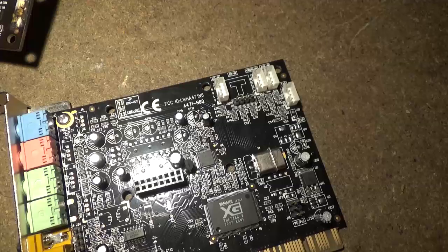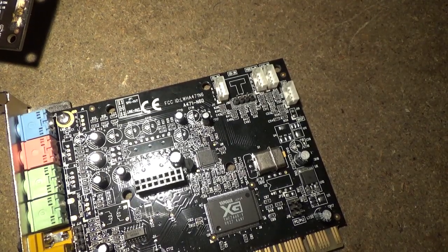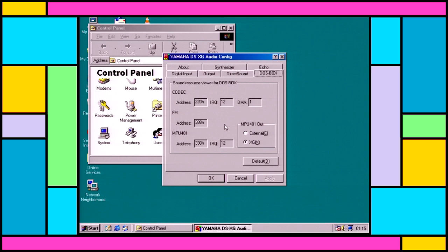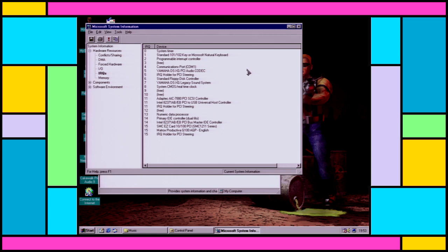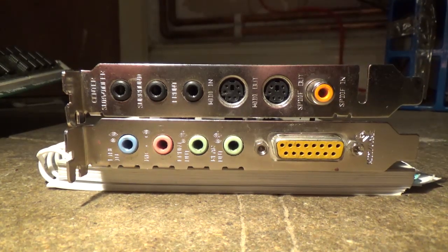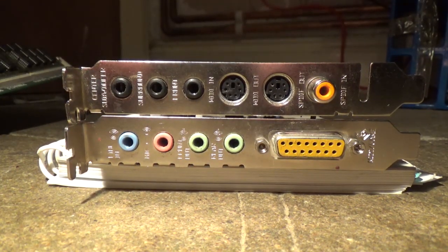This card arguably has some advantages over the 724 installed now, though, namely that it uses only a single IRQ, and it can do SPDIF when the analog sources are turned on, the problem being that it doesn't really seem to be real SPDIF, and it behaves as though an ADC is present somewhere, one which is just tapping the analog output and converting it to AES, digital output.